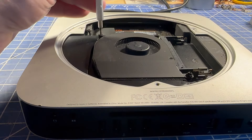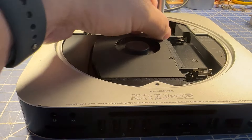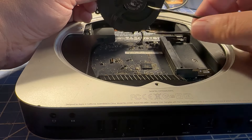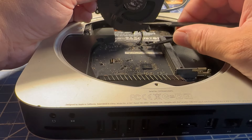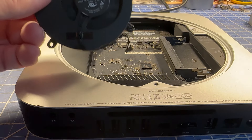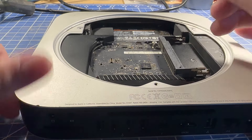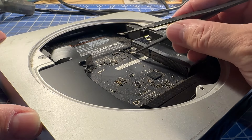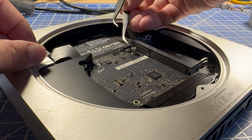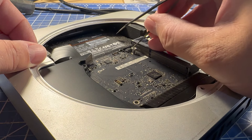We've got some Torx screws here. I'll take the fan assembly out. With those three out, we can carefully unclip this little connector here - it should just lift straight up. You want to be careful not to pull on the wires or they'll pull out of the connector. And with that out, there is another connector here - it's the same kind of thing. This runs to the front and it's got the LED and maybe Bluetooth connector. I'm not quite sure, but if you just pull the board out with this connected it will rip the connector off most likely.